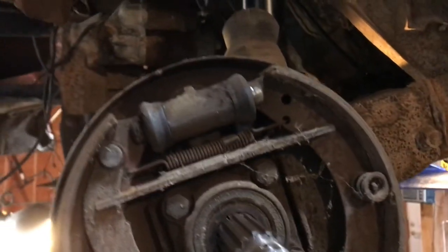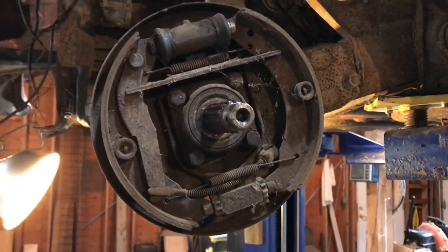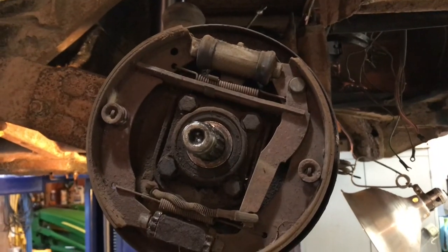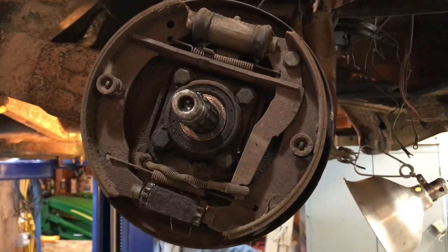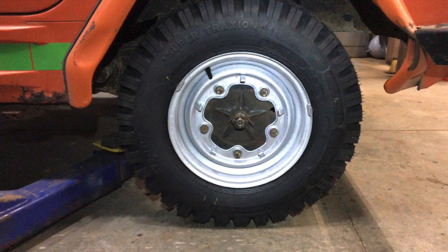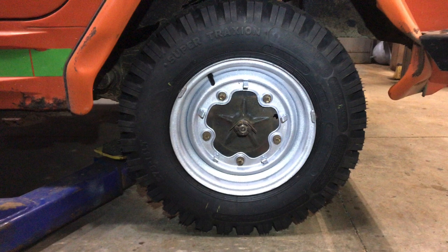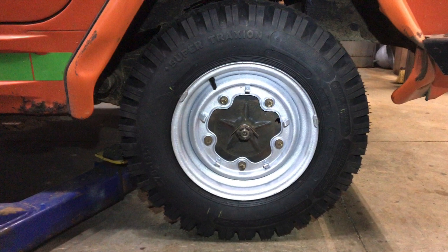There's no fluid inside the cups of the wheel cylinder, but we're going to change it all anyway because we're here. On the driver's side, the e-brake cables run the other way, which I think is the right way. All the adjusters were loose and the drums came right off — it's almost too easy, I'm waiting for the other shoe to drop. I didn't film any of the reassembly, apologize for that — it just got too hard to hold the camera and work. The brakes are on, everything works, everything bled out, and it worked great. Thanks to the Thing Shop for having great brake kits available for sale — check them out, I'll put a link in the description.